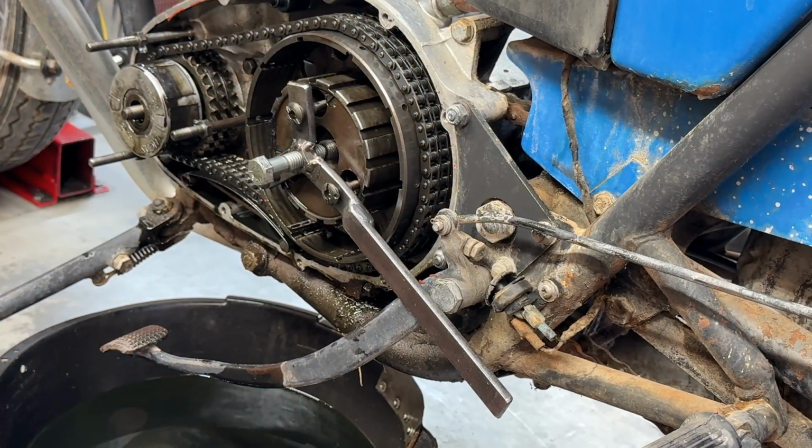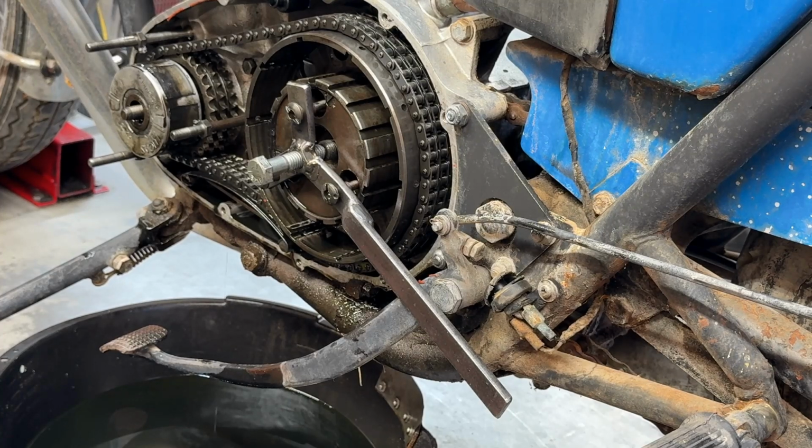All right, the heavy washer that's inside the hub of the clutch was so tightly jammed in there, I guess oil or suction or just crud or crime. It should come out. And normally you stick a magnet in there and pull it right out. Well, it wouldn't come out. And there's no room to get a hook around it or under it or anything. And I'd used up all my magnets and couldn't get it out.